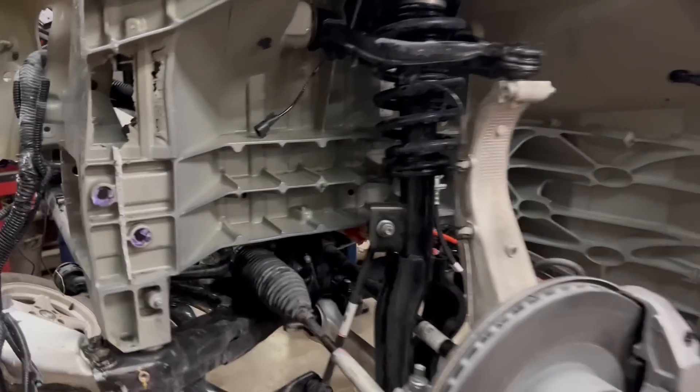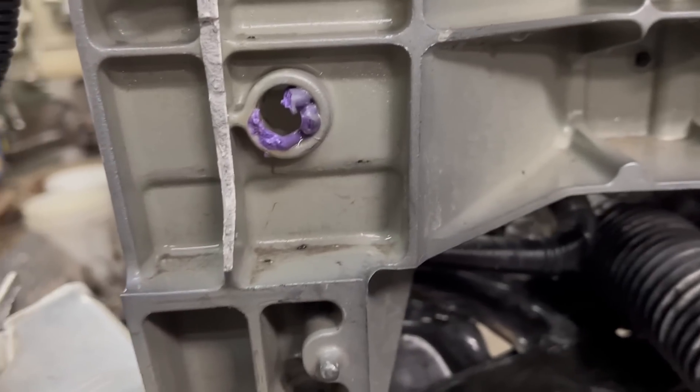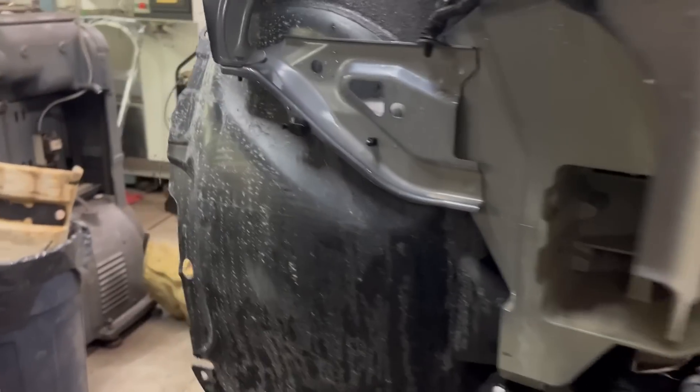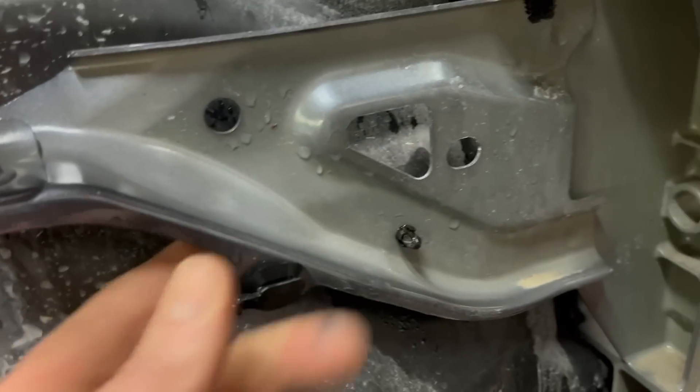This shows a clear shot of where that piece broke off. This is just a fender support for the front of the fender. You can see the flakiness of the cast there — I'll show you on the other side what it's supposed to look like. This wing supports the front side of the fender, the fender bolts on here. This is a two-piece design: this wing has three big spot welds, and that piece there is what snapped off the gigacast — that's what we're going to weld up.